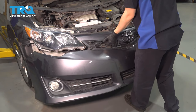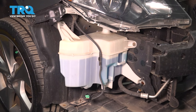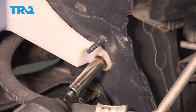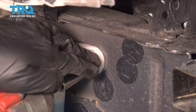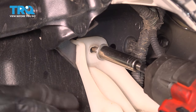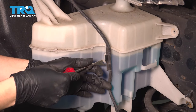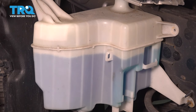Now you can take your bumper cover and pull it right off. Here's our washer tank. There are three 10-millimeter fasteners holding this on — two bolts and one nut. For this one, you'll definitely need a deep socket because it's on a long stud. On the front of it, disconnect this fog light connector — if your vehicle has this on here, it's just clipped on. Push it through and set it aside.